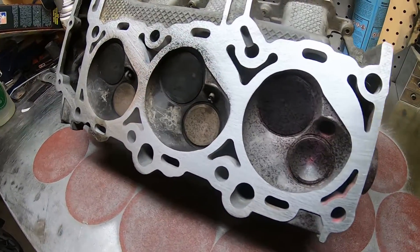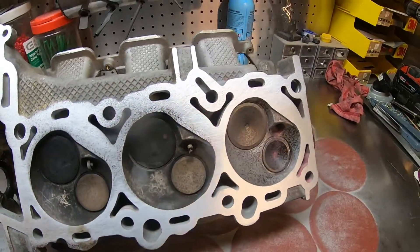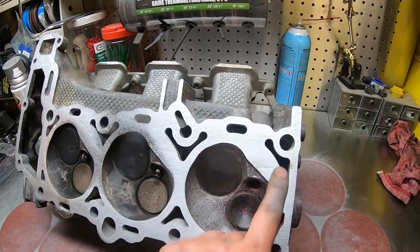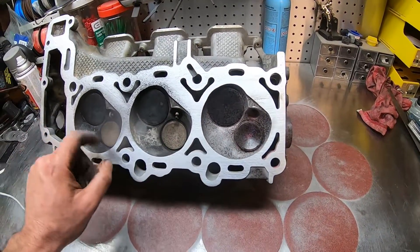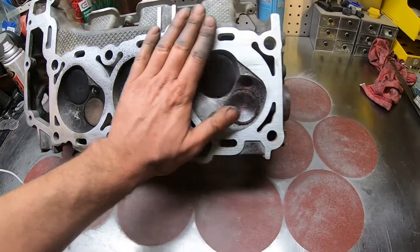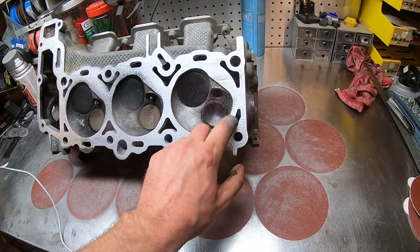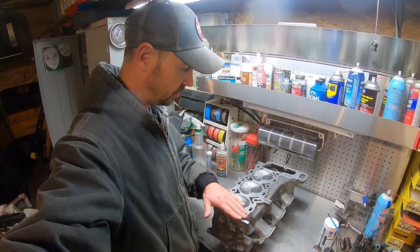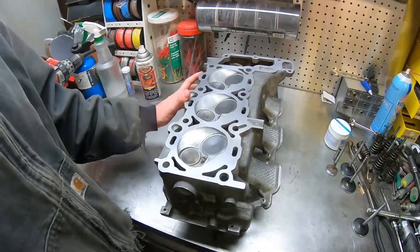I only did this for about 10 seconds and you can see it's exactly where I thought — a little low in here, but that's not a concern. I'll just keep filing until it's all gone. This is the lowest point and I'm not surprised because it's very hard to stay consistent with this pattern. If I didn't have that big burned mark in the cylinder I would have just done this step and skipped the orbital. The orbital comes in when you need to take down a lot of material quickly. If you just want a flat, prepared surface for a gasket, do this step only. If you've got a big defect, use the orbital then do this to verify your work. It's all done — no low spots left after a final scuff.